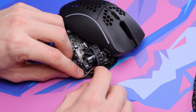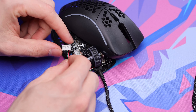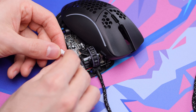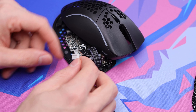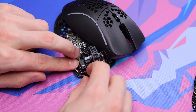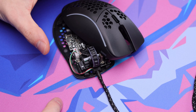With these loose wires, you're going to want to try to route them down as best as you can because you don't want them popping up in the shell or getting in the way of your switches afterwards. Just route it around and then plug this back in the right way — you can tell it's the right way because the side with the lines on it clips back into the connection, with the metal exposed on the pins. Now I have it seated back in there. Sometimes the best thing to do with loose wires is tape them down to the bottom of the shell to stop them popping up.